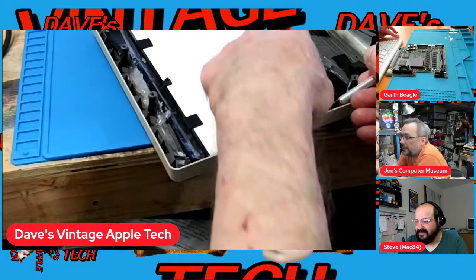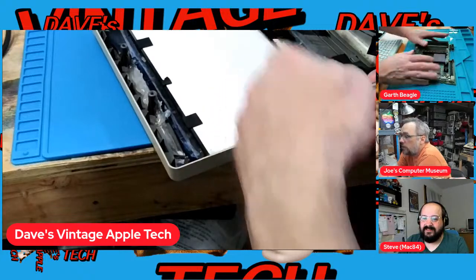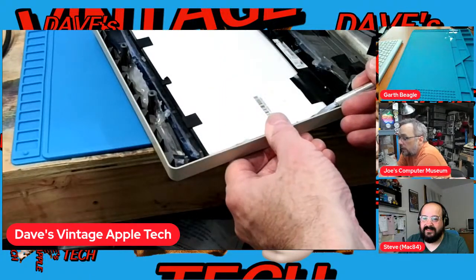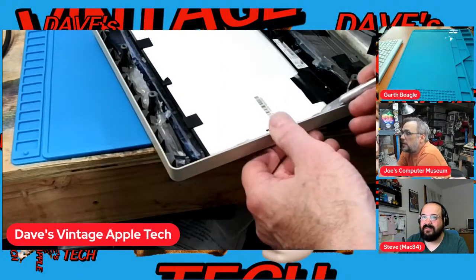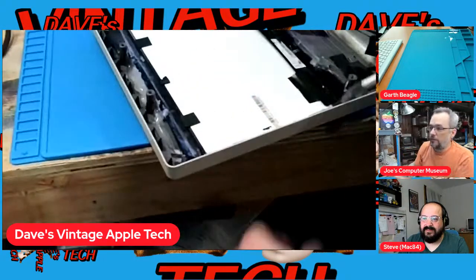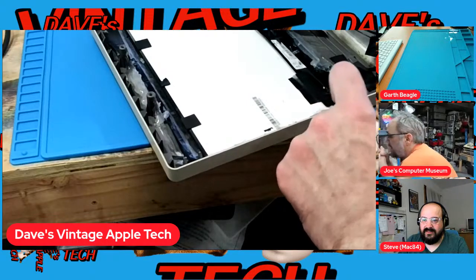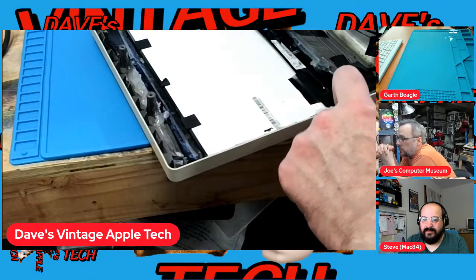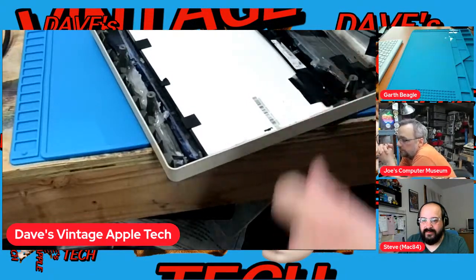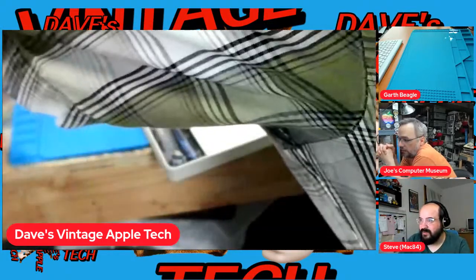So if you go to that link, Steve, halfway down, there's a Blue SCSI updater link. He maintains that as a separate project. Here, I'll just give you a link. It's in the private chat. I found the thingy. He maintains it as a separate project. You just download that and drop it on your computer and run the flash-mac.command, and it does the thing. Do I have Brew installed on here? Let's see.